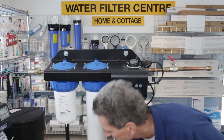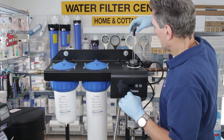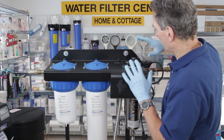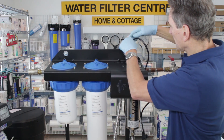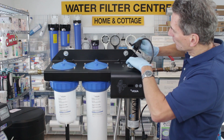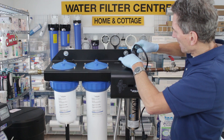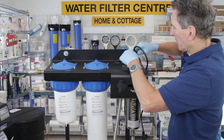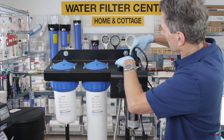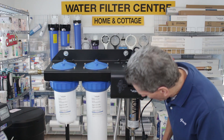Once the sleeve is in place, put the new lamp in. When you tighten the new lamp, you'll notice it only goes so far and then stops — that's tight enough. Once you've done that, the connection goes back on. There's a removable ring around the outside that locates the jumper; line that up with the lamp and slide it all the way down. You'll hear a click on both sides. Once completed, plug it back in.